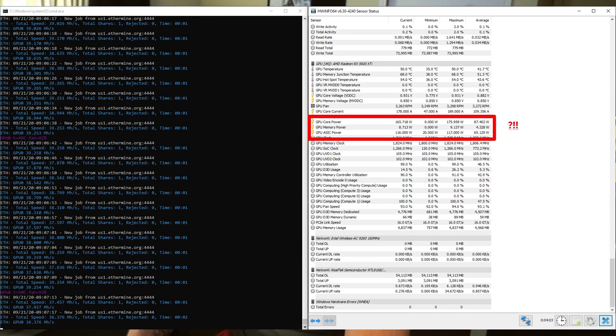The next coin is Ethereum, everybody's favorite. And you will see I was like, question mark, because the power consumption I have reading from the rig that's running 5600 XTs right now is showing those cards running around 105 watts. And that was confirmed with, of course, the kilowatt, as well as doing all the math to pull out the idle system power. And here what we saw was it basically saying core power was at like 175 watts and memory power was at like 9 or 10 watts, which means we were at like 200 watts, and I don't think that's accurate at all.